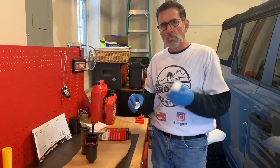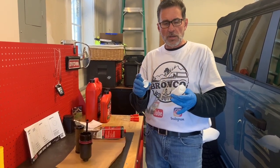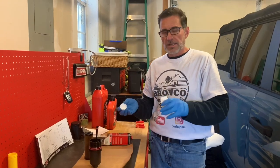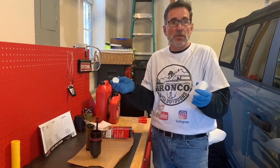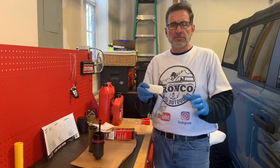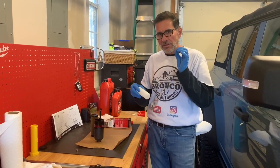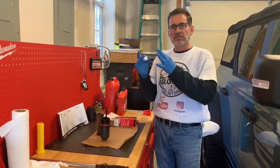It was clean. So for the sake of measuring the oil, because I did spill just a little bit, not much, I want to make sure that when we determine how much oil came out, we don't have a lot of inaccuracies in there, like a little bit sitting here and there and everywhere else. So after we measure the oil, because I'm pouring it from one clean container to another, once we figure out exactly how much we were able to take out of the engine, I'll then take a sample of that, and that'll be the oil sample that will go. That is the only exception to the rule, because if you ever try to do that with a pan that's not new, then you could be getting some of the contaminants that were in the other oil changes, and it's just not what you do at all. This is the one exception, and it's only because we're trying to determine in one oil change the quantity we're taking out, as well as showing you how to do it.